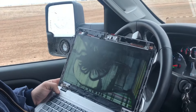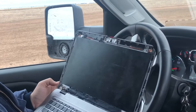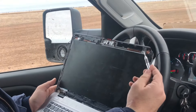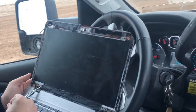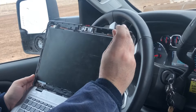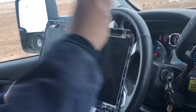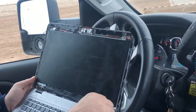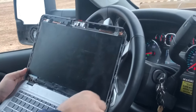I'm just pressing the screen again to kind of show you what it looks like. You can power off your computer while you're doing this — this is probably the best way to do it, but it's not necessary. There are four screws, and in the majority of laptops it's just going to be four screws. You might come across one every now and then that has two on each side, so maybe eight, but for the most part you're only going to have four screws, just on the four corners of the LCD.